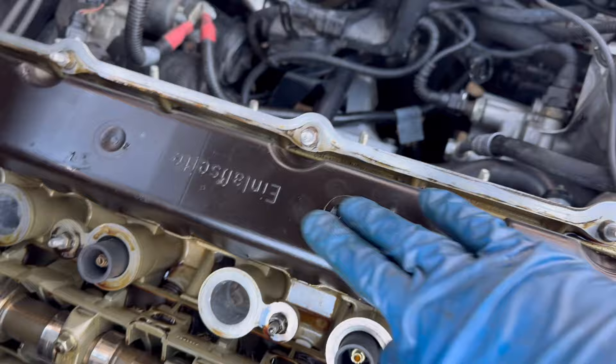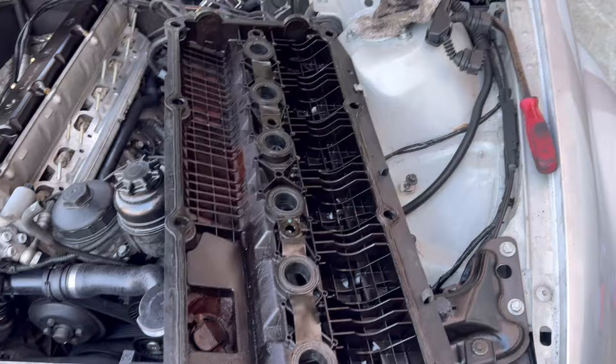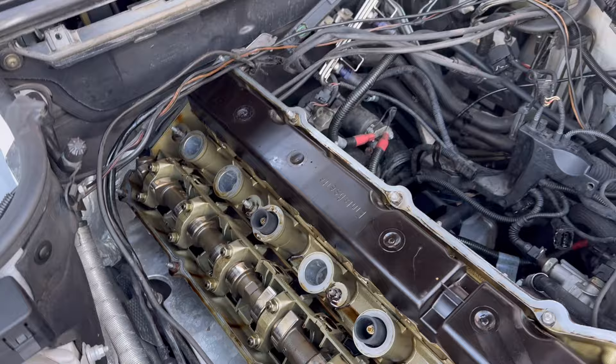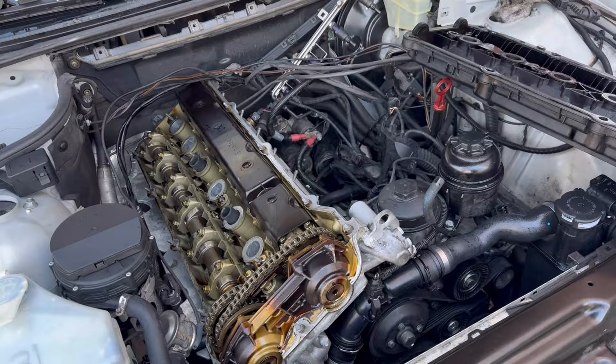There's not even any buildup on this cover over the intake cam — usually there's all kinds of crud on that. Barely anything inside the valve cover. I don't really recommend trying to clean this stuff out — frequent oil changes are really all you need. It will splash up there with detergents already in there. You don't want to knock some of this stuff loose and send it through your oil galleys. So I'm going to go ahead and clean this surface up, make sure it's nice and clean, hit some of these spots with the Scotch-Brite just to make sure it's a clean surface, let it dry off so we can get the new gasket to seal properly.